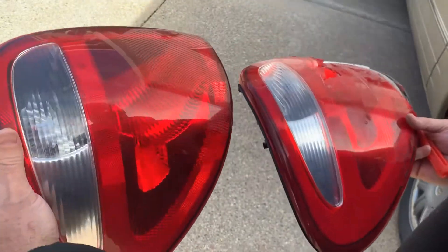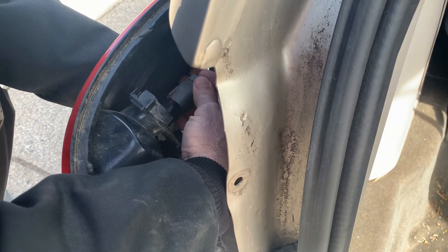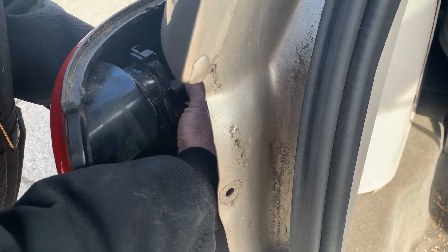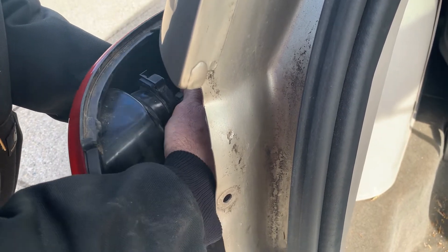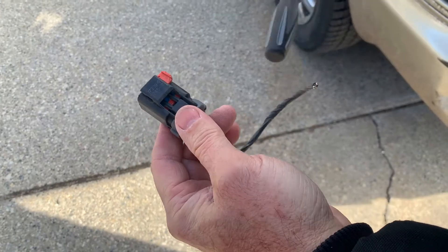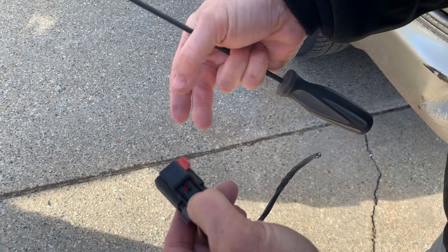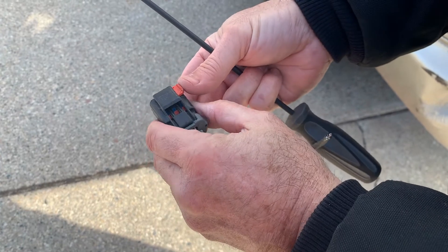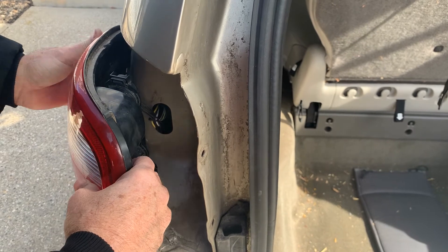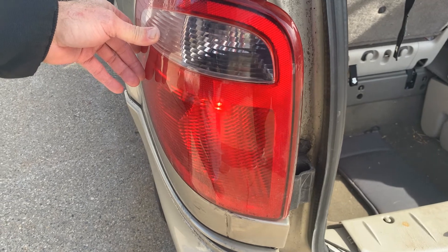So they're not that expensive, and it looks a heck of a lot better. We're going to reinstall this new one — I'm going to plug it in real quick and double check it to make sure it's working. I'm going to slide this down on top of it, just like that. You've got this lock right here — you push in there. It was a little harder to see the lock, so you've got to pull it over like this, then you can push down and pull it off. Once you snap it back in place, you click that over and it locks. Before I button it back in, I'm just going to turn the turn indicator on to make sure it's working — and you can see it's working.